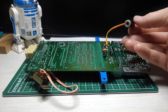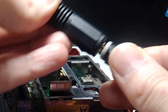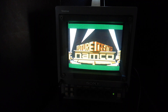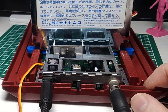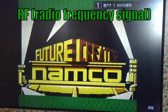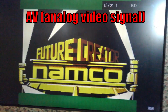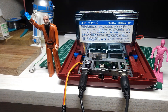She's all soldered up — let's try it out with AV cables. Snap her together, give her some power, and we have it. It's connected to my Sony PVM and looks very nice — I suggest you all use a CRT television if you're using one of these. Let's check the RF output on a newer television — the RF signal looks like that — and I flip it over to the video signal. Yes, definitely much better. Both signals work on this.